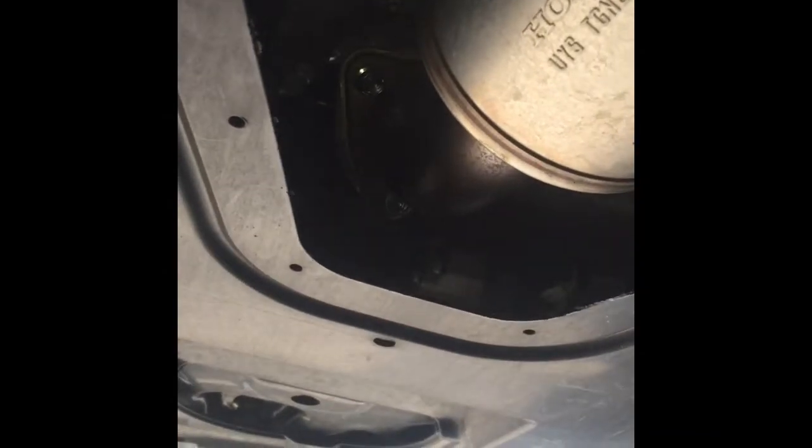Okay, have the front pipe in, gaskets in, bolts are all on, nutted. You know, this will probably help you guys out. It's not real critical here on the front pipe, but at least on the downpipe, leave everything loose. Mock the car up first. There's some error built into the flanges. The holes are a little bigger tolerance than they need to be. Our turbine outlet flange actually has a slot built into it that lets you rotate the downpipe, helping correct some errors.